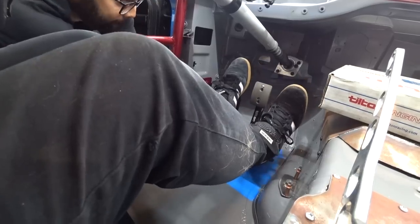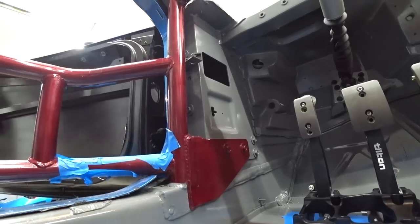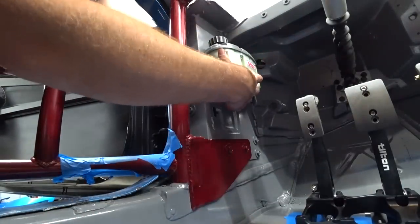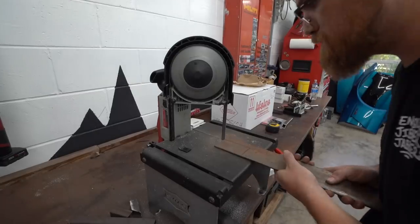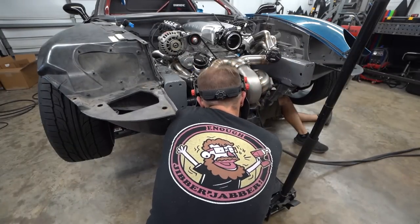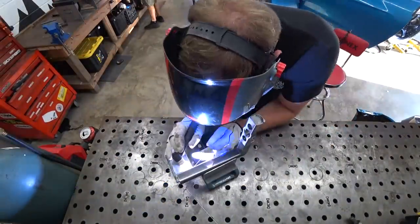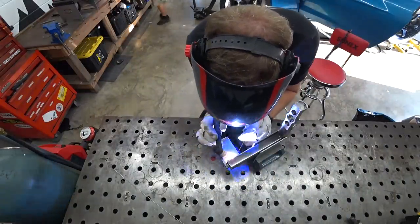We spent a lot of time playing with the pedal box position — it's critical to how the car feels and I've never had a floor-mounted pedal box like this. I finally found a place I was happy with, checked reservoir placement, and handed it off to Josue while I got back on the turbo mount. I got the lower leg piece tacked on and cut the plate from quarter-inch instead of thinner material because there's going to be a lot of leverage on it. We got it all in position, tacked it in the car, and it was time to weld it out.